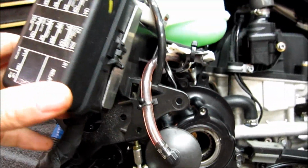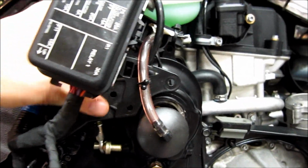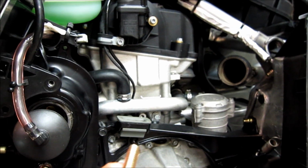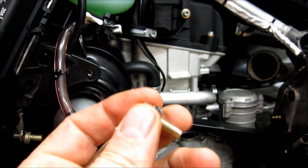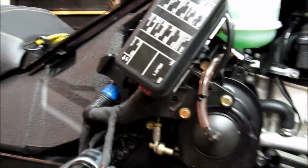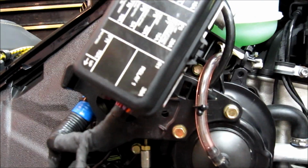So now the next step is to take our electrical water bottle bracket up here and put that all on. Make sure you use our 4 bolts here. They should all have washers on them. There's 4 of those to put on. Okay, so we have our 4 bolts holding our bracket on, and those are all torqued to 100 inch-pounds.